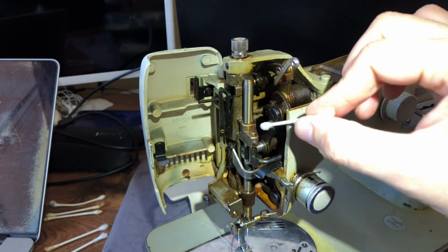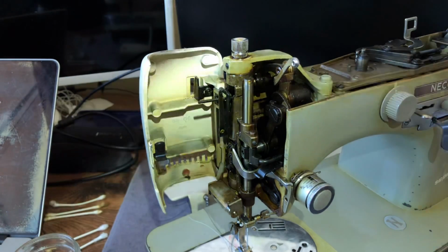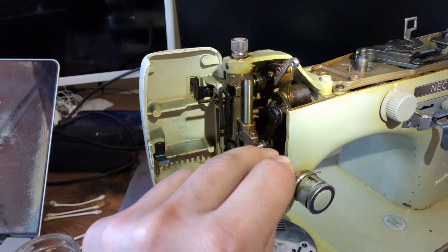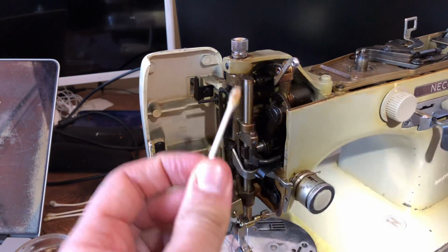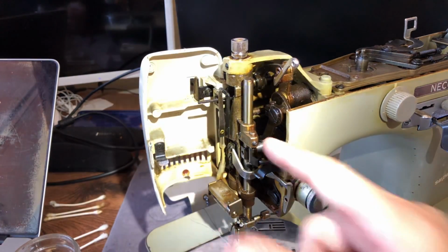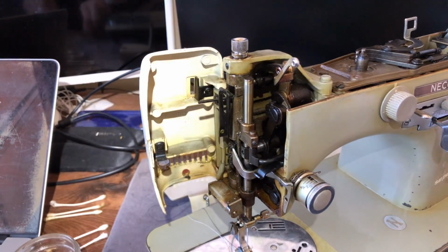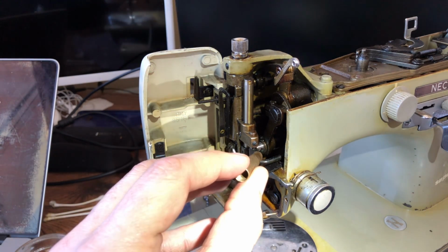And if we're careful, and let's say you have one of these and it's stuck, and that's very common. Like I said, I just assumed this was going to be stuck, and I was so grateful it wasn't. But when it is, you need to be patient. I've talked about this before. Patience is a virtue, and it definitely is when it comes to restoring vintage sewing machines. So let the alcohol sit. It's going to dry quickly, but it'll start to soften old oil, because what happens is you end up with old oil on the inside of where the shaft is going.